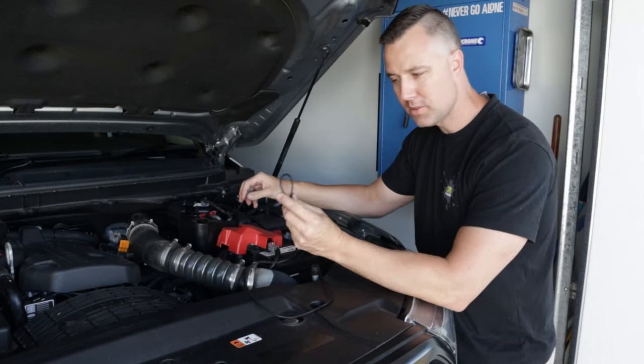All right, so onto the switch. This switch we're not using. We're using the push type switch. We've just got to change the wires over. So this one's got three wires, this one's got four. The fourth one is connected up to the illumination circuit in the vehicle, which will illuminate this when you put the lights on. So what we'll do is we'll go through now and cut them off and join them up.